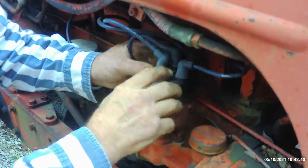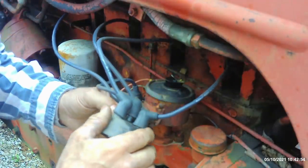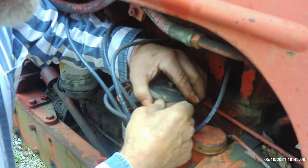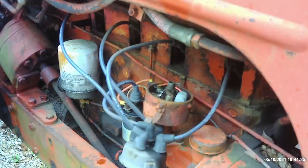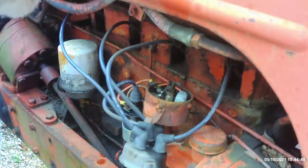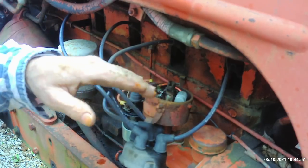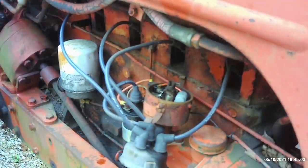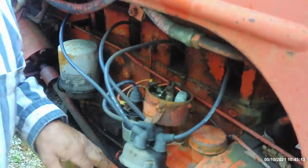We hope we don't break anything popping the distributor cap off. A little corrosion inside there — not too bad. Sometimes those dust shields break just for the fun of it. It definitely wants to open and close. I've got fire right there — I've got fire at the points. For some reason it's not going through the points, so I'm going to get my points file and touch those up just a little, very gently. Turn the power back off. The distributor itself doesn't look too healthy, but that's okay — we'll get that cleaned up.